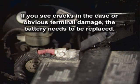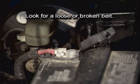If you see cracks in the case or obvious terminal damage, the battery needs to be replaced. Look for a loose or broken belt. The alternator keeps the battery charged when a vehicle is running, so if the belt driving the alternator is broken or slipping, the alternator can't do its job and the battery will run down quickly.